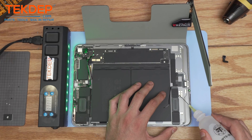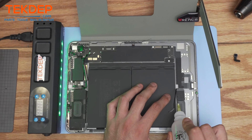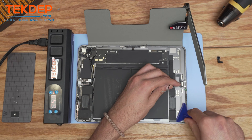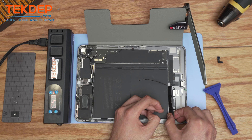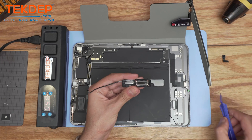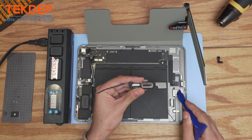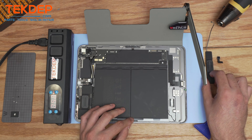For the bottom loudspeaker, there is a magnet in between and it's very strong, so it's always good to apply a little bit of isopropyl alcohol. There is very strong resistance because of the magnet in the center of the bottom speaker, so you'll have to apply a little bit of pressure. Pay attention here — there is very strong adhesive and it sits between a lot of magnets, so be gentle while extracting the bottom loudspeaker.